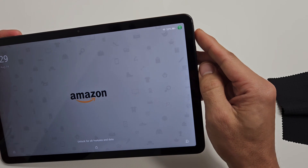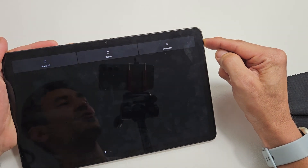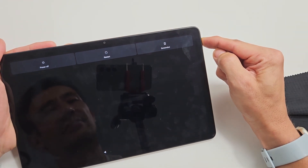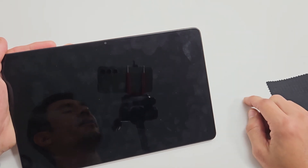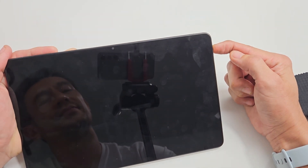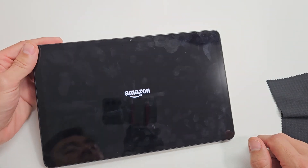After tapping, go ahead and flip it over and tap the power button to see if your screen comes on. If it's still off, press and hold that power button for 16 seconds until it's fully turned off, let go, wait three to five seconds, then press and hold again. Wait until you see the Amazon logo, then let go. Hopefully you're now out of the black screen.